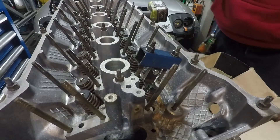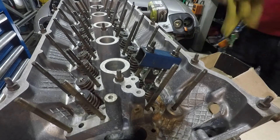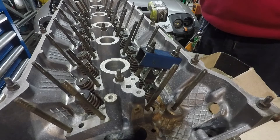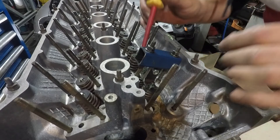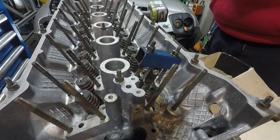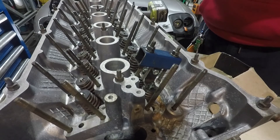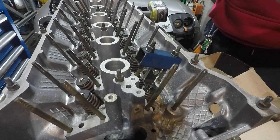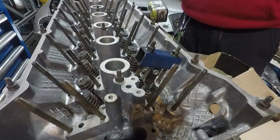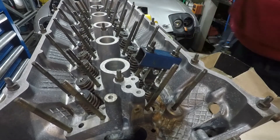Tiniest amount of assembly glue — this stuff will dissolve pretty much on first run of the engine. Now here you can get a closer look at how I get these collets on without a collet tool. Yes, there are tools out there, but for the two heads maybe that I'll do a whole year, it's probably not worth me purchasing them, considering it's this easy with a little screwdriver. My engine assembly machinist — he tells me all the time, he says why don't you just leave the head here and I'll put all your valves back in and change all the valve stem seals. And I said, you know what, this is actually one of the jobs I find very therapeutic. Although it may be a little time consuming, just working on the head in a little bit of silence — it's sort of my little break from the world. So that's it, collets are in, that assembly glue is going to keep them in place.